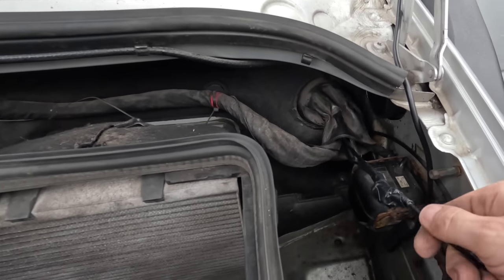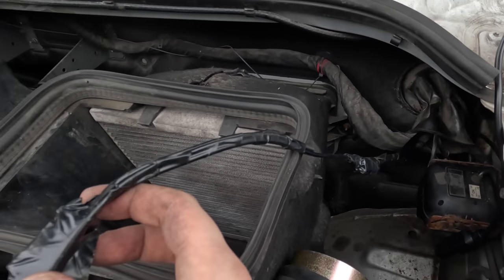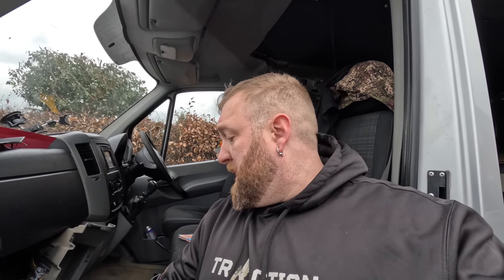So what we're going to try and do is connect on the plugged ends. We're going to stagger them so only one has to go through at any one time, and get all four of those through. I'm also going to leave a twin cable through there, probably round where the battery is, which is purely for running lights or DRLs. That's a future thing, but while I'm in here, while I've got the glove box off, future-proof it, jobs are good.